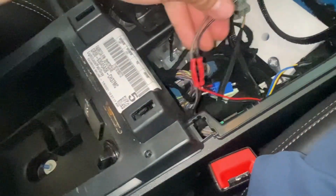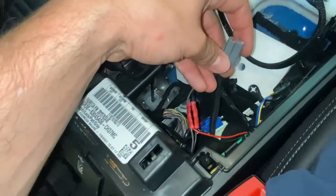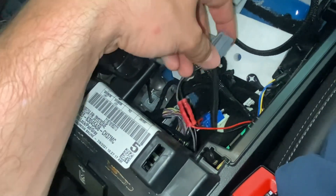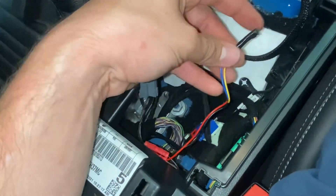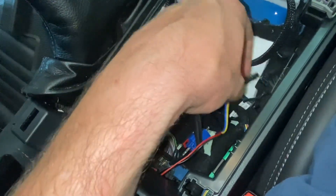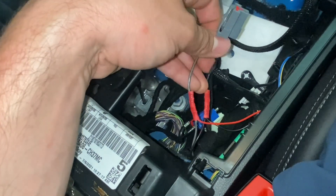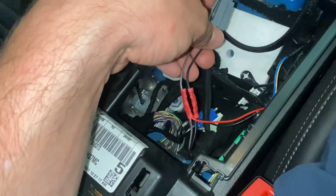How I had originally done this was I spliced into the cigarette lighter. The cigarette lighter had power when the car was on and was seemingly off when the car is off — but as we know, that's not fully the case. Those are my two wires. These other two are extra accessories — if you wanted to data log or add a scramble button you could, but we didn't need those. So basically what we're going to do is break this connection and add in our switch.